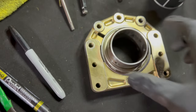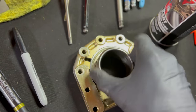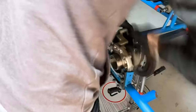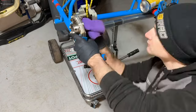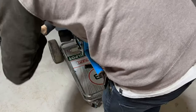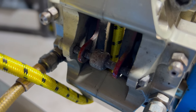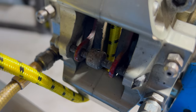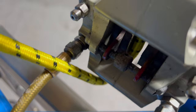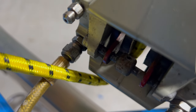I'm not replacing the bearings — they run very freely, there's not much play at all, and I've just completely cleaned and lubricated them. The slider pin in the brakes is manky — that's going to go, we're not accepting that level of corrosion. But the grub screw in the middle that you need to remove has rounded, so there's no way to remove it normally. I'm going to remove the nut and bolt from the end, then saw through the middle with a sharp hacksaw — that's how we'll get it out — then replace the whole pin and make it nice again.